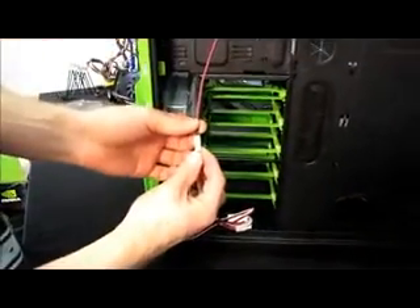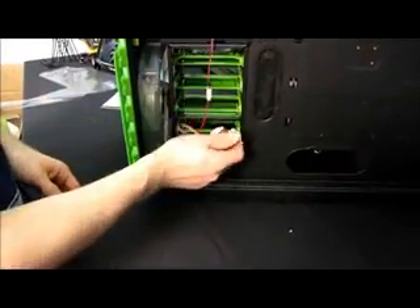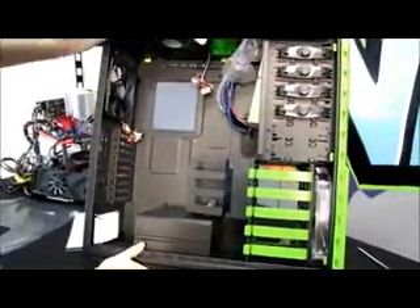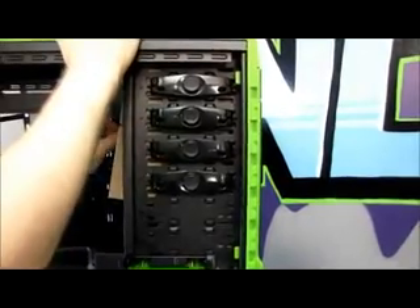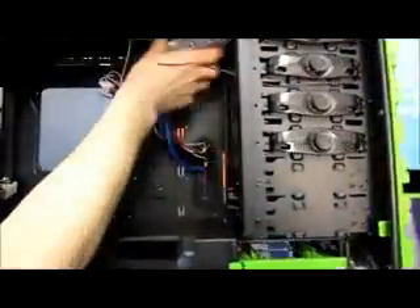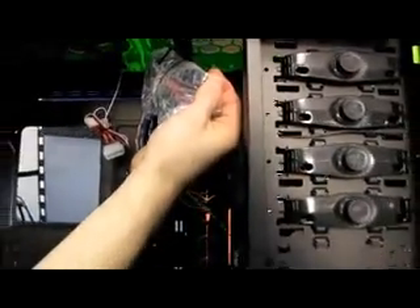Here's the LED power for the front fan, which is controlled by that toggle switch at the front. The fan power can be plugged in via 3-pin or via a 3-pin to 4-pin Molex adapter that Cooler Master includes. For front panel connectors — USB 3 is still done via the non-header approach, so you'll need to run USB 3 cables out the back of the case, maybe through a PCI bracket, and plug them into the back of your motherboard. Front FireWire, front audio, and front USB are all pretty standard.